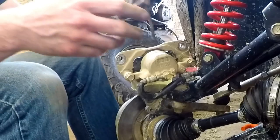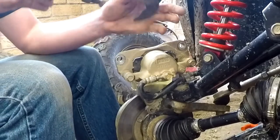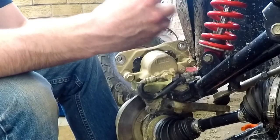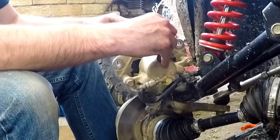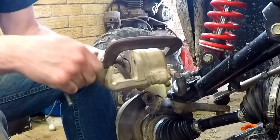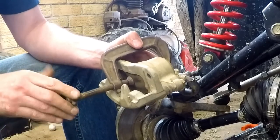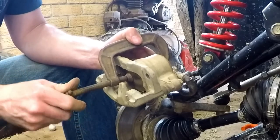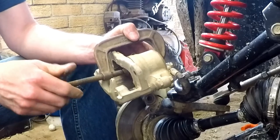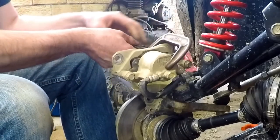All we're going to do is take our small C-clamp and wind her down. This one is a little bent and twisted just a bit but it'll work good for these brakes. We're just going to slip that over here over our pad and then slowly give her some cranks and press that piston back in. The fronts are just like your typical car or truck brake caliper — they work the same way. You'll see when we get to the rears though, they're a little bit different. Once we have that, we're going to take our C-clamp off and grab our new brake pads.